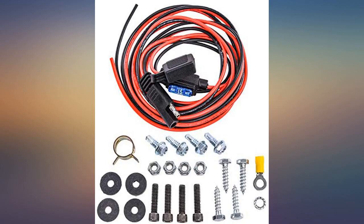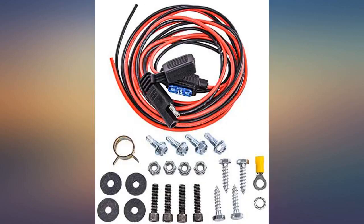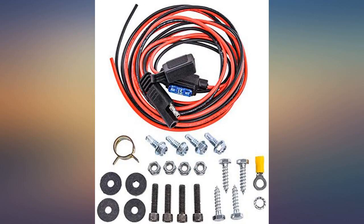For $350, you hope it's well made. The bracket is certainly heavy duty since these are designed for automotive use. I'm curious why they don't use weatherpack connectors and a weatherproof sealed relay — the connector is the old-school power plug from the 1970s CB radio, and just a standard cheap relay. I upgraded to a waterproof fuse holder as well as a waterproof relay.